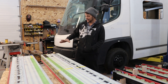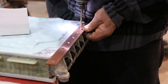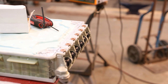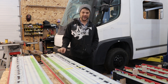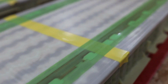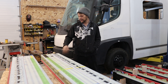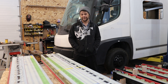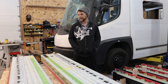One of the big things is we had to take the large terminal off, which normally came up here. A copper bar went on the backside where we were able to bolt to each of the terminals coming out and create a kind of a bus there, which neated things up really nicely. There was normally a ribbon which ran the entire length of the module holding the BMS connection, able to look at every pack of 40 cells in parallel. We had to replace that with a ribbon of 22-gauge wire, simply because that ribbon was aluminum, it was hard to solder to, a little bit weak, and in my opinion susceptible to damage.